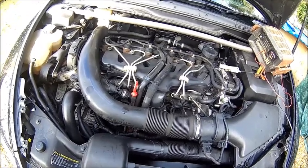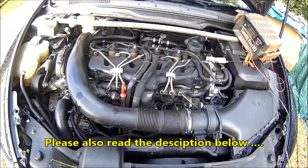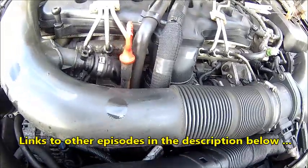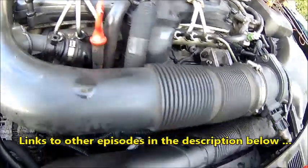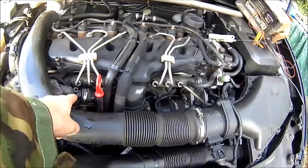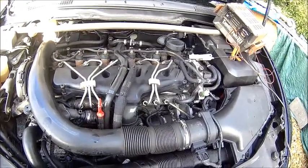Welcome back, back on the Volvo again. Since we now cleared all the faults, I had a quick spin and it came up with Glow Plug number 1 and number 3. Looking at the whole thing, I got an idea where they are — they're the ones you can't easily get to. It's persistent, so it's not a random one.